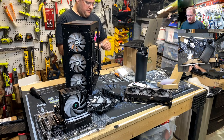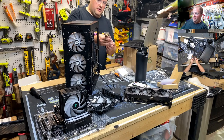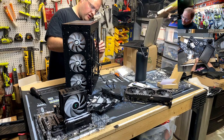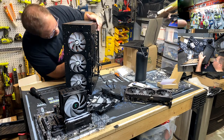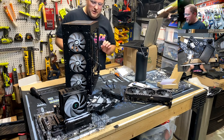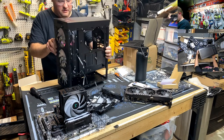Guys, I don't think I talked about it in the beginning, but this is definitely a mid-spec build, I would say. Actually, if you're trying to play every arcade game on the MegaCade reliably, this is about as low as I would go. Scan's machine is fine. We're just after a bunch of CPU horsepower, and while we were at it, we got the badass video card and doubled the RAM, so it's going to be good for him for at least another five years. His current build lasted him 6 years. This is about a $1,000 build-ish, and for me, that's as low as I would go for an arcade.